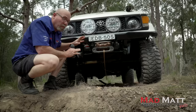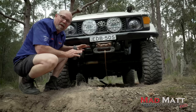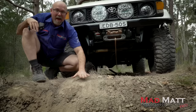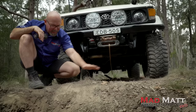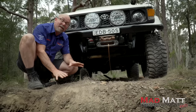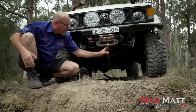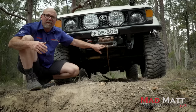That point there is a huge stress riser and that cable is suffering hugely going over that. That's where you'll lose a bunch of the winch's power and it's also one of the places where the cable could break in this scenario. This is really one of those things where you go, I can do it if I have to, but it would really be one of those last resort type of scenarios. See this flat area created by the cable being pulled into the dirt - if this was a rock shelf, you'd want to put a blanket or an air damper or some sticks to protect your cable so it doesn't get cut by the rock. With synthetic ropes, that's one of their weaknesses - they do cut quite easily. If you are running a steel cable, it's a different scenario, but the steel cable is not going to enjoy going around that at all - you're going to destroy your steel cable.